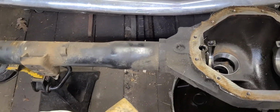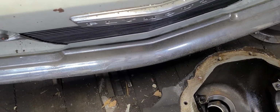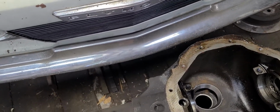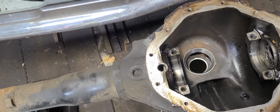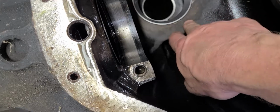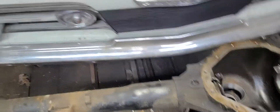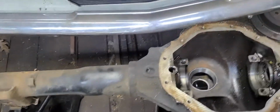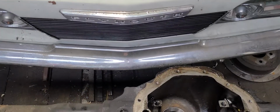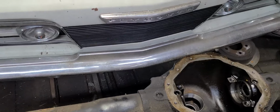until you've got it. Now, I could have gone and heated this area up with a torch. That probably would have worked some, but to me, I just kind of felt like that was maybe a bit excessive, and I didn't want to cause any sort of issues with the surrounding cast iron. And then not only that, you're heating up just this area, but then the area all around it is trying to cool or get to the same temperature. So anytime you're doing this, you're fighting time. Time where the stuff that was in the freezer was in the freezer, and the stuff that came off of the grill, that pinion shaft bearing, was really, really super hot. As you've seen, that was what I consider a total success, because it just fell right down on there nearly.